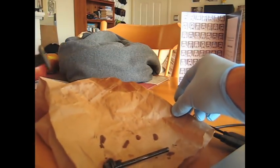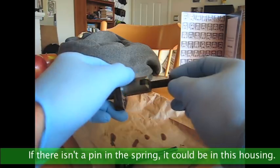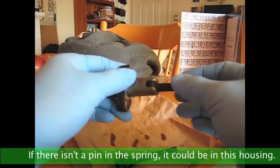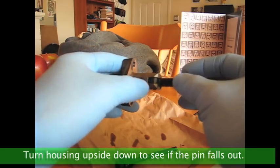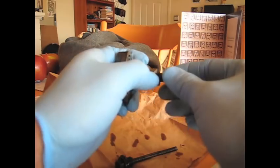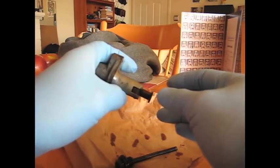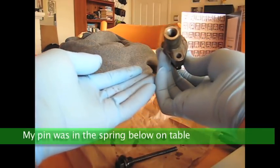Here's resetting the CCT. There's the spring stuff. Press this, that little guy, and push in this plunger. And then you turn upside down, turn your hand, and it will fall out. So I'm going to press this and push in the plunger. Yep. Turn it upside down. Something's going to fall out, supposedly.